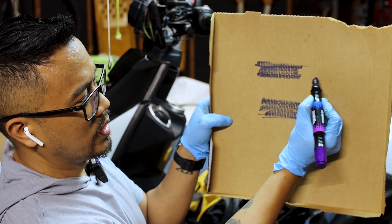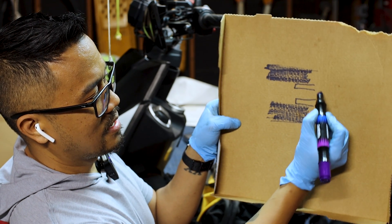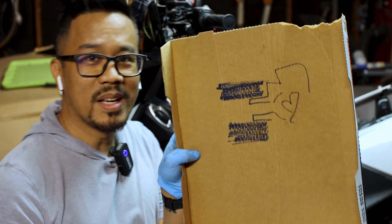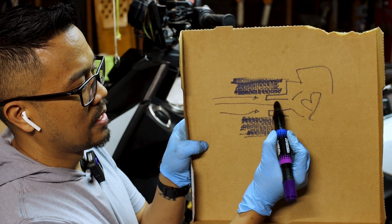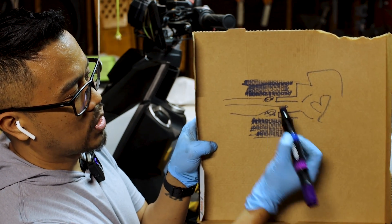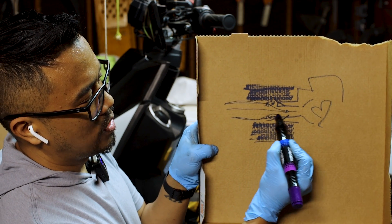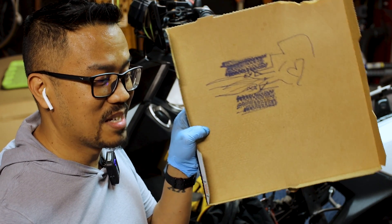The intake manifold has a part that goes in here and then it goes into the carb doing its air stuff on the inside. What's happening is that when the air comes in — this way, this way, and this way — some of the air is running against this flat area right here and causing a little turbulence there. So the idea is to cut these in so that the air moves in more of a flowing fashion, kind of narrows it in there a little bit. Hopefully you can see this and it makes any sense.